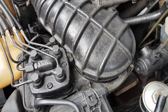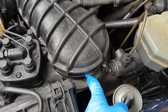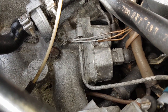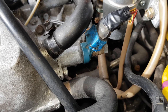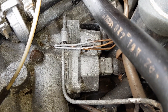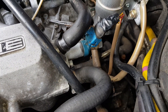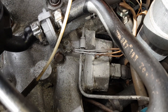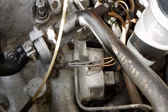In previous videos I had to put my hand through the air intake to the plate in the airflow meter and raise it just to get fuel pressure to start the car — something this unit should be doing. There's also a secondary piece, the cold start valve, which I've tried three of. Once I get this one sorted, cleaned, and confirmed it's not the issue, then the final step could be the cold start valve, and if that doesn't work it's most likely the thermo switch. So step by step we're going through the process of elimination. It's two Allen hex head bolts to remove this — one on top and one underneath.